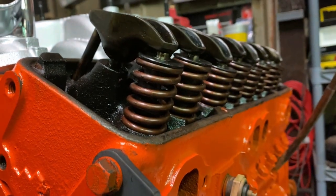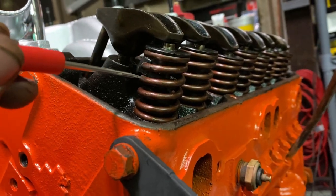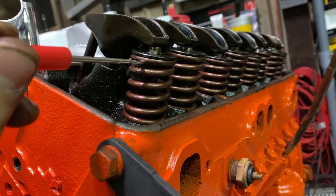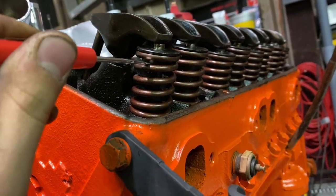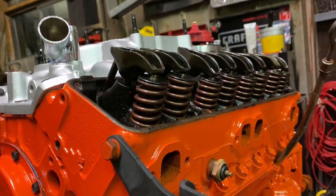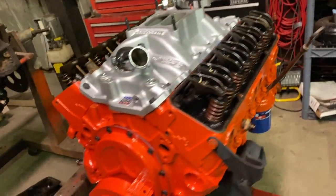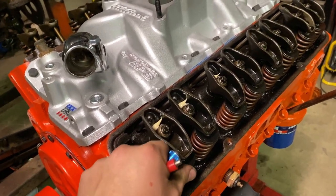To use these valve springs, I actually need either an oil splash guard to use those O-rings, or to not have to use the oil splash guard with these valve spring keepers, I have to use an umbrella seal. It's actually the night before I plan on working on everything, so I just wanted to make an intro slash update.